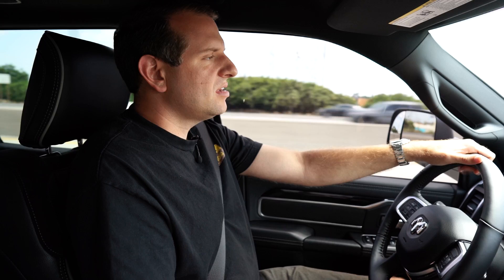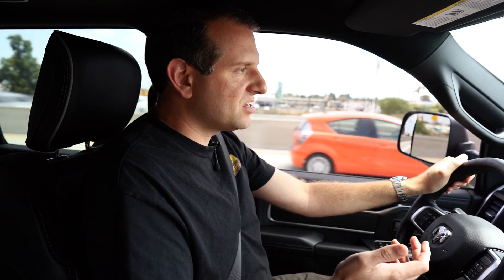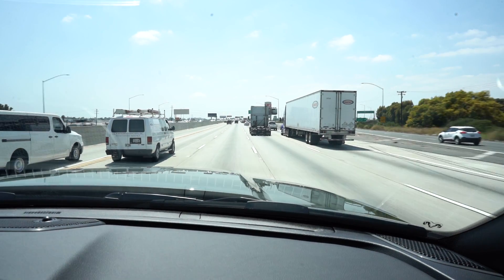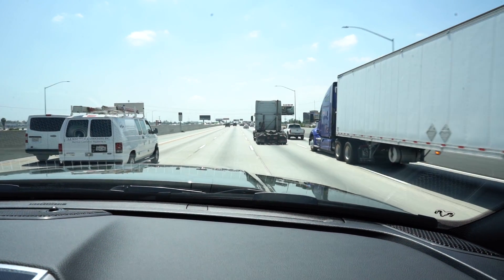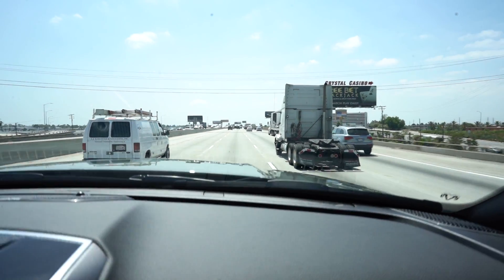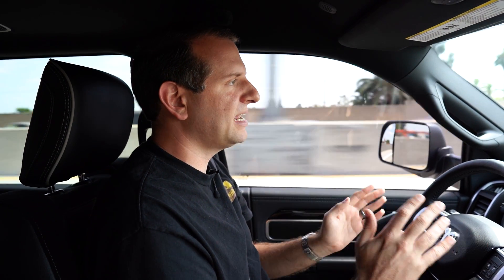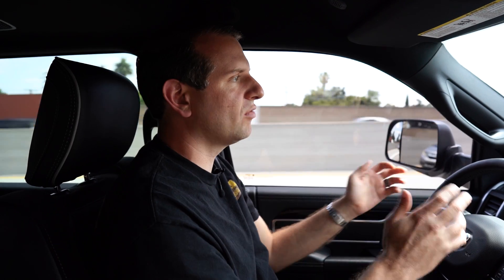We're on the initial test drive now. You already feel a difference from running the stabilizer, but now we need to adjust it. You'll want to go on a relatively flat road. I found a great nice flat spot on the California freeways here. Finding a very flat spot in the road is critical in order to get this thing set straight. If you go on a section of road that's either crown left or right, the big off-road tires you're most likely running are going to exaggerate that left or right pull. So get a nice flat section of road, and it'll really aid in dialing in your stabilizer pressure to find the best happy medium.